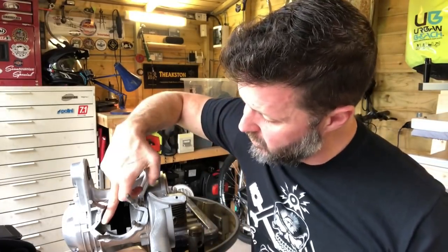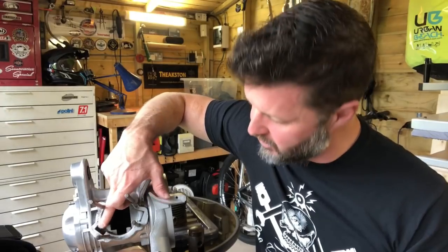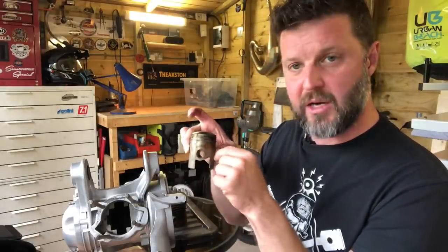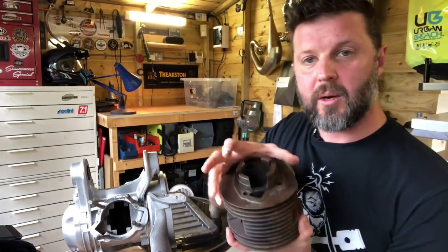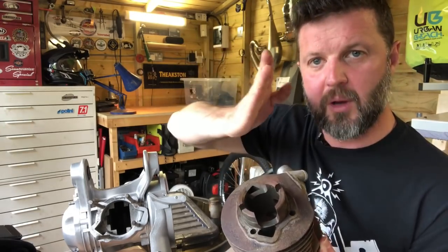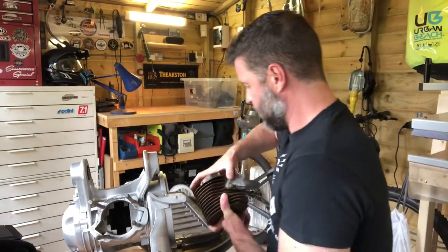He's done some work to the inside edges of the transfer ports on the casing - some very traditional work to widen these out, round off the corners and the edges. He's taken a piston - not this one, but a piston similar to this - one that would have a strengthening rib across the bottom. He's removed the strengthening rib. He's widened out the spigots and chamfered and radiused and flowed them to make it wider and more flow-compliant. He's done the same work to a cylinder, widening out the spigots on each side, radiusing and chamfering them all. The cylinder wall transfers he's dropped, chamfered, flowed and radiused. The same for the outside edges of the transfer ports to match the work done to the casings. This is very traditional work - blueprinting, tidying up, matching, flowing - all sorts of various words get used.